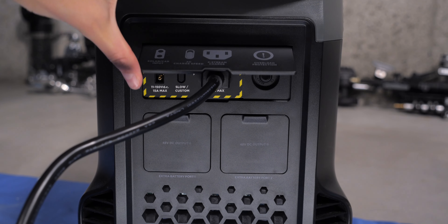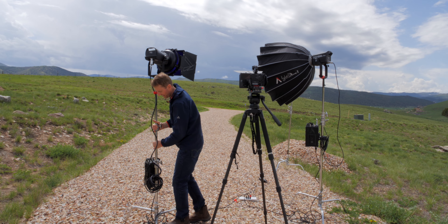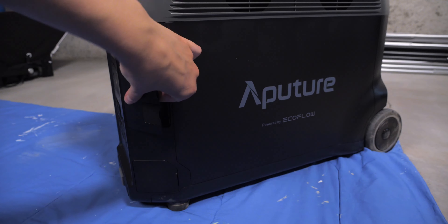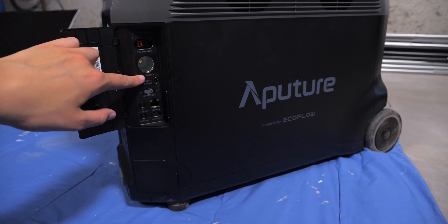In terms of overall battery life and long-term viability, at 6500 full recharge cycles — a complete drain down to 1% and charge back up — you'll still have 50% capacity, which is pretty interesting. After 3500 full recharge cycles, you'll still have 80% capacity. That doesn't sound great in some respects, but it's actually very, very good for lithium-ion battery chemistry.